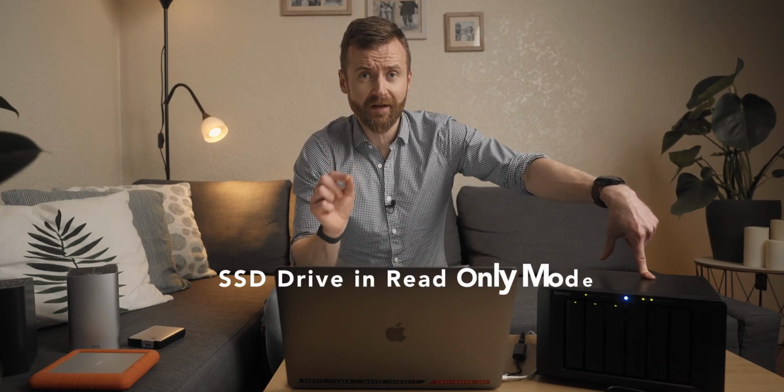So basically RAM and SSD will work like a buffer to keep the most used footage available with increased speed. A side note, if you want to use SSD, set them to read only, because if you're allowed to write to SSD, this will make your system work slower. That's the limitation of the SSD. So once you add everything up, you can use this NAS not only for backing up your footage, but it can become a fully blown NAS server for video editing.